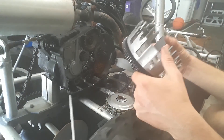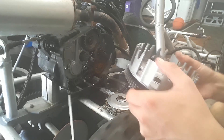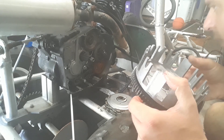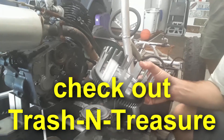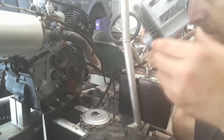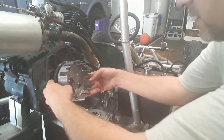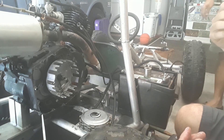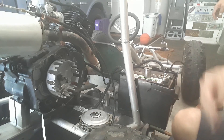I didn't technically have to take this off. This oil smells like regular car oil — that's probably the problem, I'm not joking. So you probably need to use brake cleaner and clean the frictions off, then re-soak them. So you won't be riding it today. By the way guys, my brother is here from the Trash and Treasures YouTube channel — I'll put a link in the description. We're going to clean this up because this smells like regular car oil. There are friction modifiers in motorcycle oil that make a difference. We're going to clean it up and try to put it back together the right way.